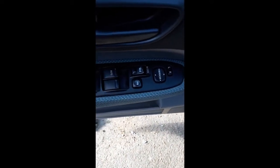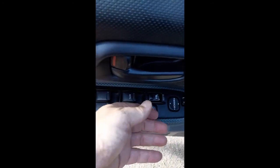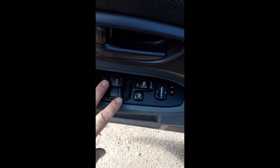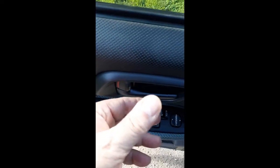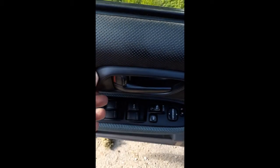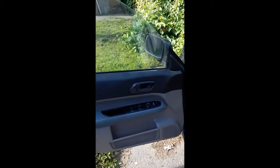Remember to connect your connectors on this console. So when you install the door card, you may want to pull the wires out so they hang out this hole. Then you connect this console screw. Then you connect this sort of fitting, this plastic friction fit fitting, and then you put in the screw, and then you are done. So taking the Subaru door apart is really, really easy.